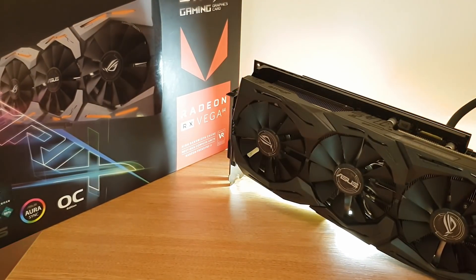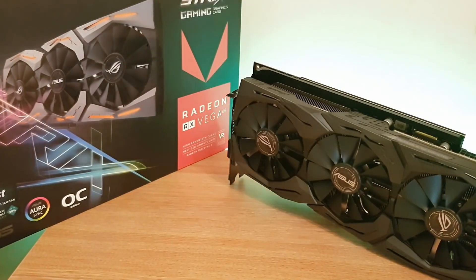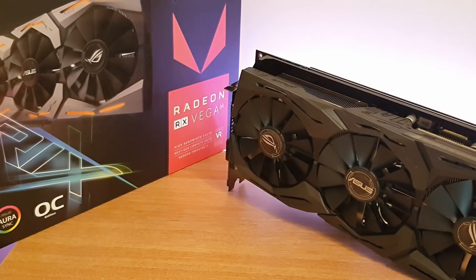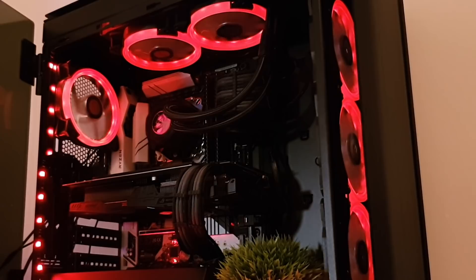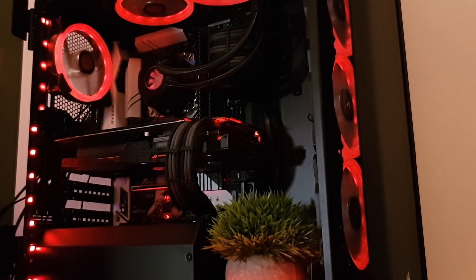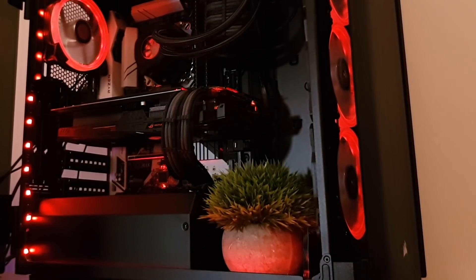For me, the Strix Vega 64 is now running cooler than ever, and that's only amplified when using Radeon Chill and keeping the FPS within my monitor's FreeSync range, so the new pad and thermal paste is definitely doing a much better job than the stock solution. So with that drop in temperature across all workloads I've tested, I'm more than happy with the results of this quick little fix. No, you shouldn't have to do it, but if you are suffering issues, then at least you know there are easy to apply solutions. I hope you've enjoyed this little investigation into the Strix Vega's thermal solution - being able to drop temperatures and even increase clock speeds a little thanks to that extra thermal headroom has been more than worthwhile. If you found it interesting, feel free to share this video around, like and subscribe, and I'd love to know if any of you are planning to do something similar with your cards and what results you've seen from it. Take care, and I'll see you all in the comments section down below and in the next video.